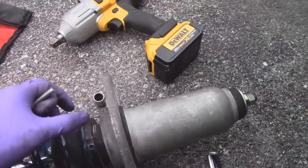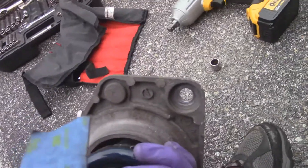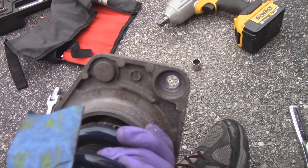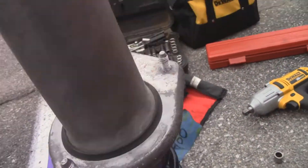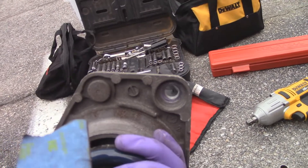It was a 12 millimeter to take off the screw that goes to the bottom of the suspension. This is the top hat, and at the bottom of the top hat that hole is where the 12mm goes in and holds it to the body. It's actually a very nice design — you can drop the top and then hold it in place with that one screw.